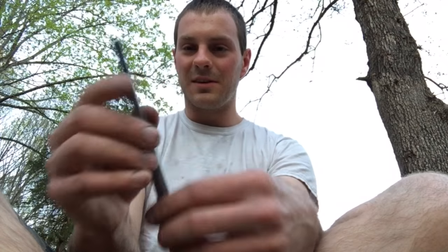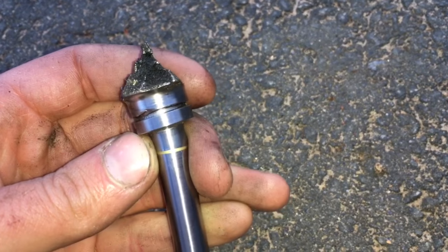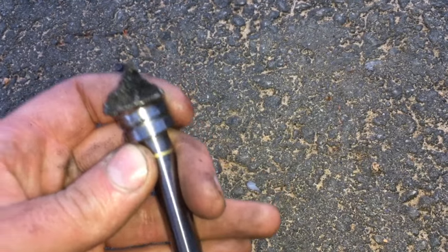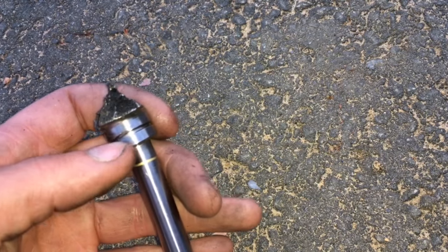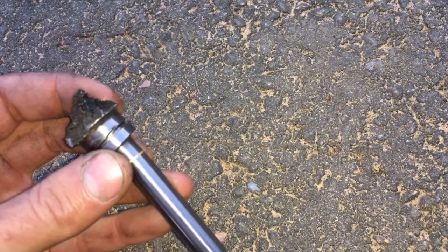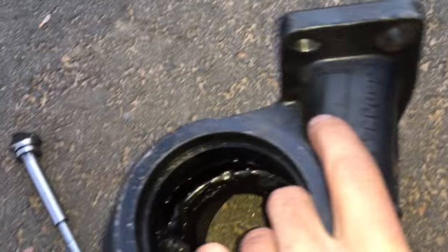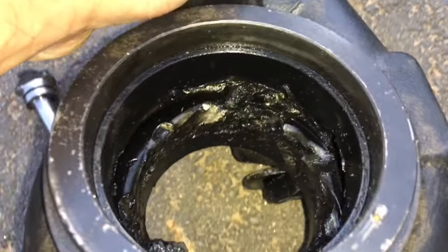And another thing I thought was interesting is somebody clearly hit it with a hammer. Looks like he also forced in the shaft with the rear seal and kinked it in there, because that would not happen. That gouge would not happen from just a normal failure, because that seal, the way that mark was made right there, the only way you could do that is if you're pushing it in, and he gouged the shaft right there with the rear seal. The rear seal isn't even in existence at this point. And there's a good shot of where all the turbine wheel went.